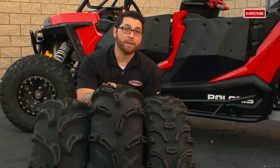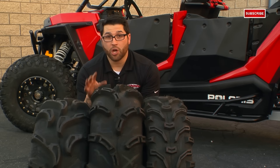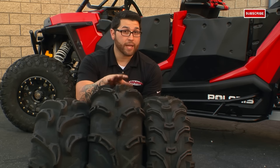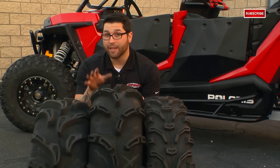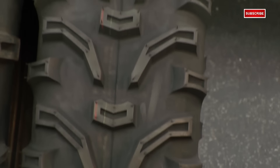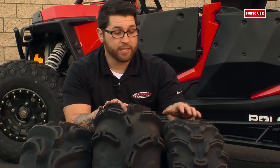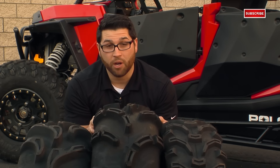As for mud tires, like I had mentioned before, technically you can break them down into three levels of riding: light, medium, and heavy. Mud tires will generally have taller lugs with huge self-cleaning grooves so they can cut through the nasty muck, and most of them are in formation like a sand paddle and generally have a 6-ply construction. The reason for that rather than an 8-ply is because it allows the tires to stay lighter as they get caked with mud but still offer a good amount of abrasion resistance and puncture resistance. These are the Kenda Bear Claws, popular here because they can handle lighter mud pits but are still capable enough to ride on normal surfaces like trails and even harder pack stuff. They have a 6-ply casing which keeps them light, but they're also available in the HTR model which is an 8-ply for extra puncture resistance.